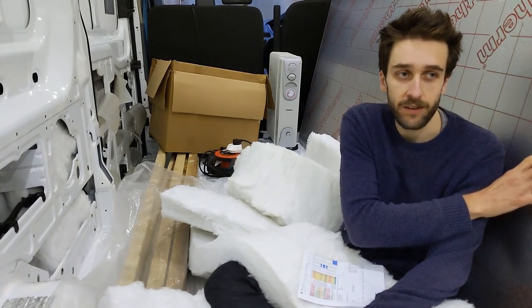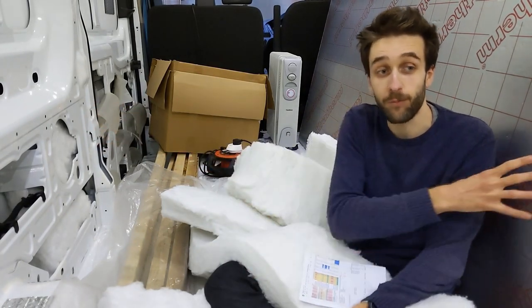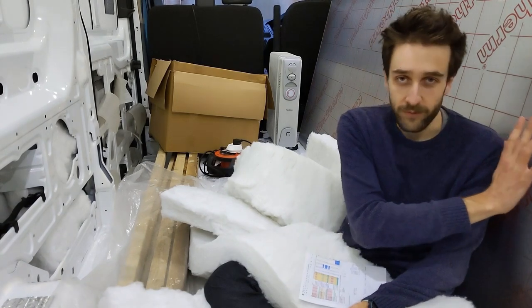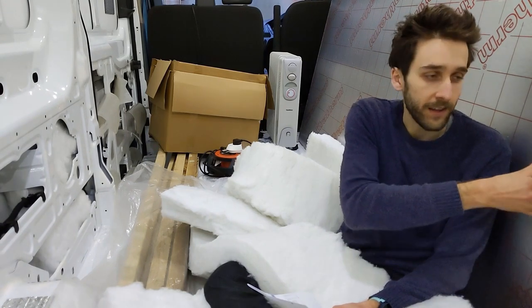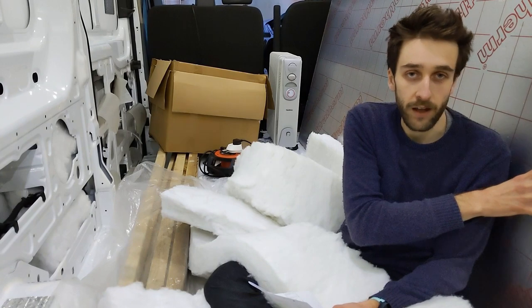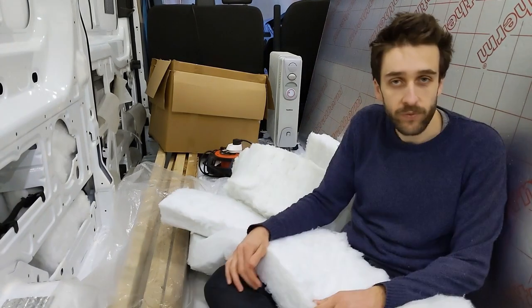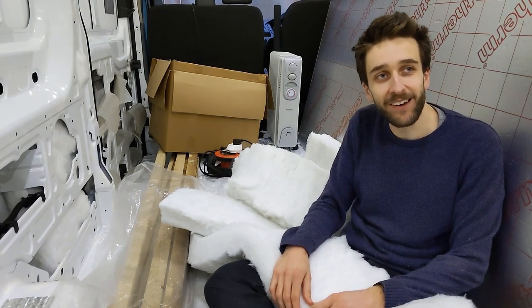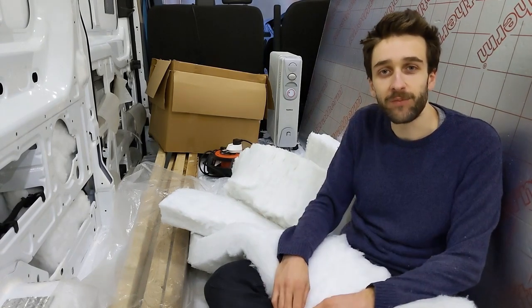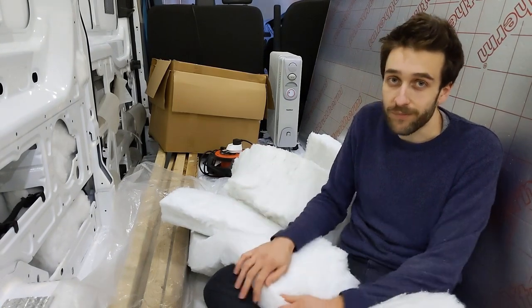With these boards there are three different types: XPS, EPS, and PIR. The PIR board, when it's cold outside in the van, actually gets worse — it's not as good at insulating. So you need to keep it warm for it to perform better. It starts degrading quite a lot when you go below 10 degrees C. But from what we're looking at, it has to degrade quite a lot before it even gets to the same level as the other two types. So we've gone with PIR, and because we're going to have a heater in the van anyway it's going to be warm in here. It was honestly a minefield — we were just sitting on the laptop for hours at a time researching insulation. This comes out the best, and the Therma Fleece comes out one of the best soft and fluffy options. New rolls arrived today.